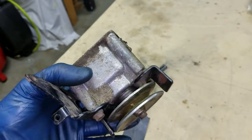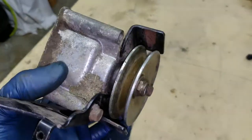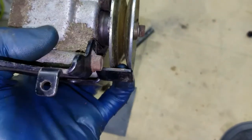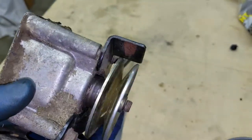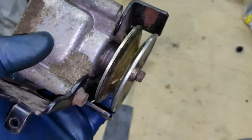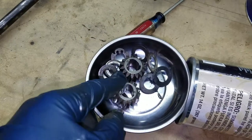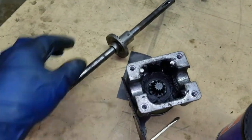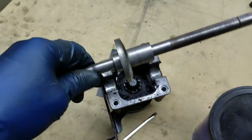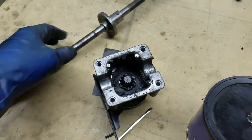Here's the other side of it. There's nothing going on with this pulley - it's not like a snowmobile pulley or anything. It doesn't change sizes by expanding or contracting. It's all one piece. This is the rest of the transmission here. These are the bushings that hold the shaft in place. It's basically a ring and pinion system.